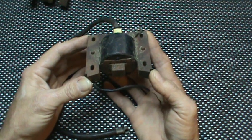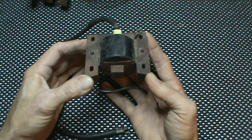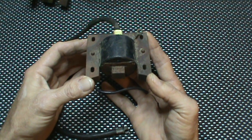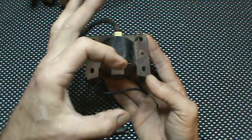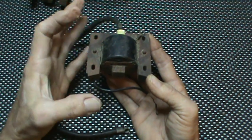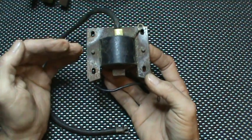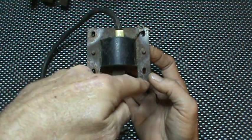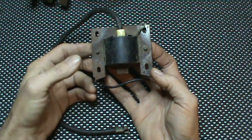When I say external — the horseshoe coils were under the flywheel, which made adjusting kind of cumbersome because you had to pop the flywheel off to get any adjustments made to set your gap away from your magnet. Your magnet was actually just on the crankshaft itself, separate from the flywheel. The flywheel was just a big piece of cast iron. This introduced the magnet being attached to the flywheel. The magnet would come around, charge points would open, and throw your spark.